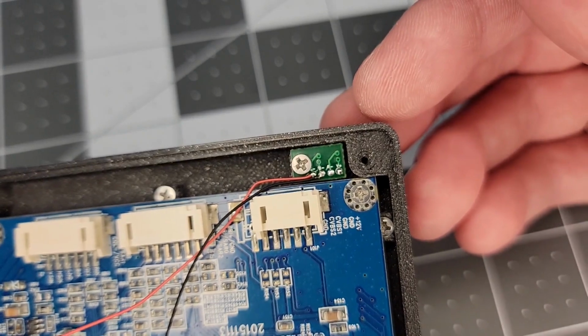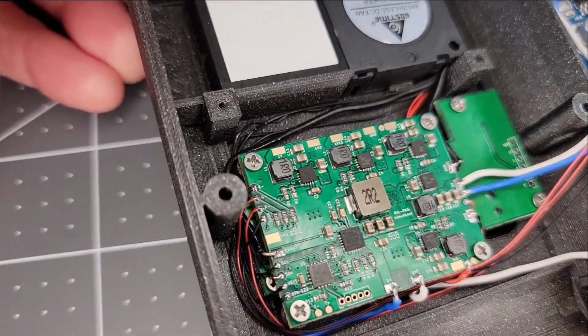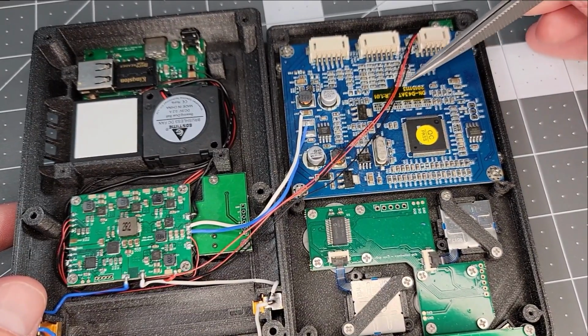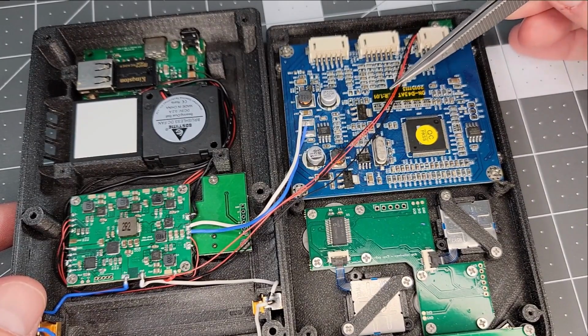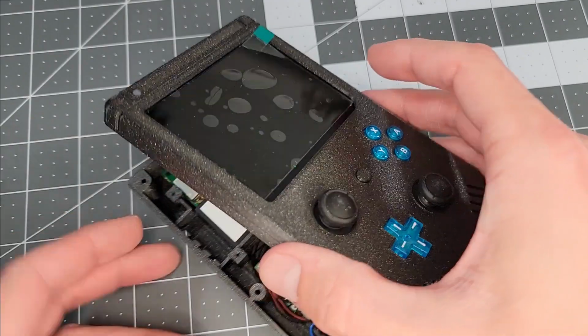Next up, we need to solder 4 lines for the LED with 30 gauge wire. My wire color options aren't unique, so not great, but here's what it looks like now. Some strain relief is provided by laying down a piece of Kapton tape over the 4 wires here. A quick test indicates the LED is working, so we can move on.